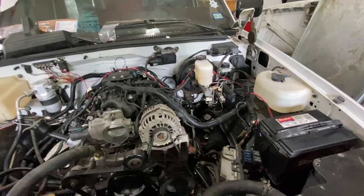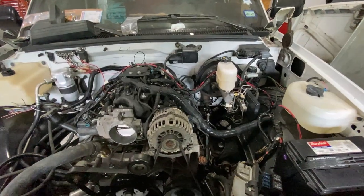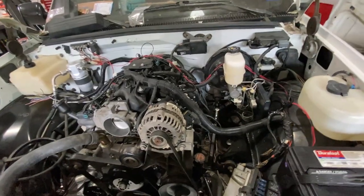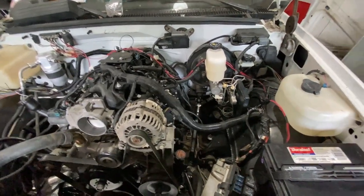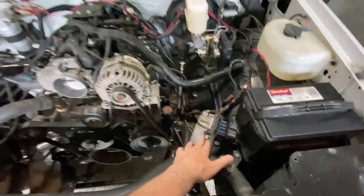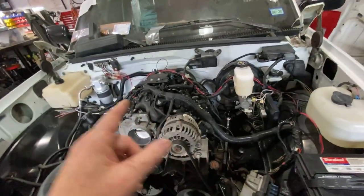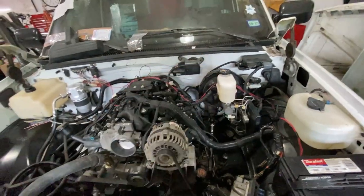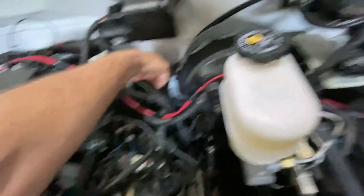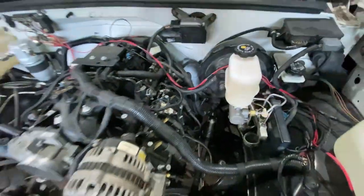For VSS, your speedometer, the plug-in connection is at the tail shaft of your transmission, whether it's manual or automatic. You need wiring for both — I mean the OBS computer and the new computer. Your LS PCM needs to know the engine speed and how fast you're going and other parameters, and the OBS needs to know it so that your speedometer will work. So I found the wires that came up to the back of this harness right back here — the exact same wires — and spliced them in here. That takes care of speedometer.